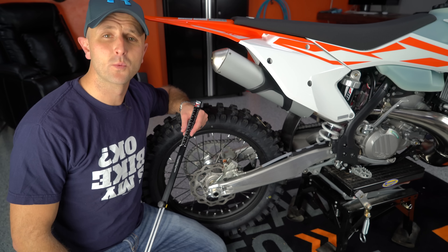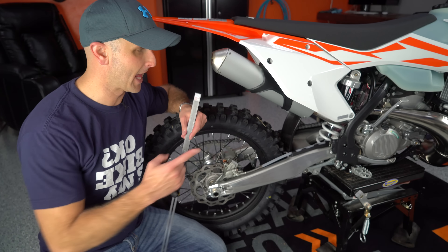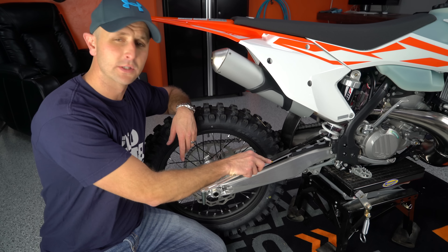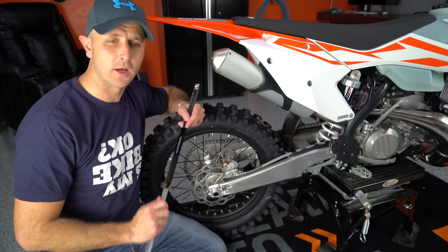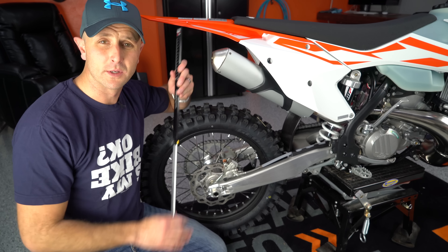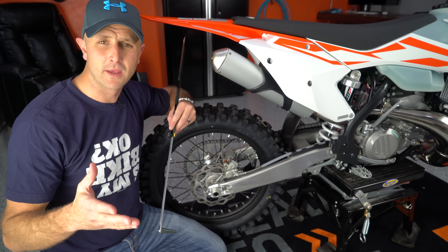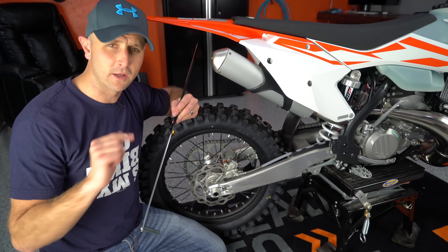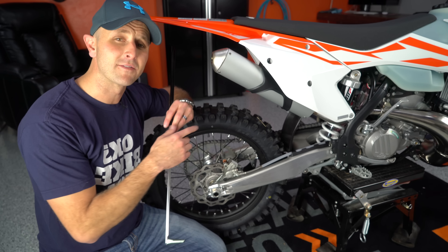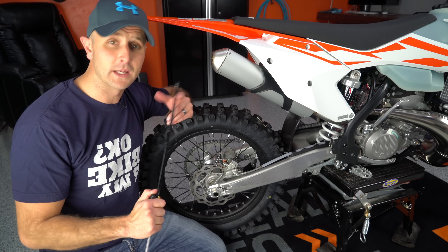While we're on the subject of suspension, we need to make sure we have the correct amount of sag on our bike, which is essentially just adjusting the tension on the spring on our shock. You can use a sag scale or a measuring tape — you'll need a couple of people to help with this. I've got videos on how to do that on my channel. You might need a different spring depending on your weight.